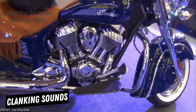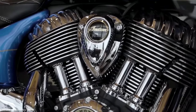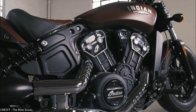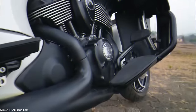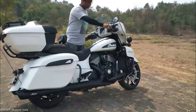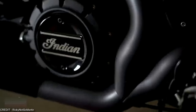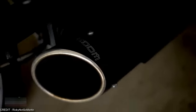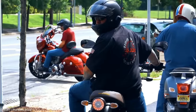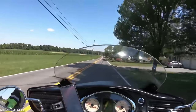Finally, the engine makes clanking sounds. Although the iconic Thunderstroke engine used by Indian in the majority of their motorbike models is a wonderfully engineered performance-based torque monster, one of the most prevalent complaints from Indian motorcycle owners is the sound of the engine clanking. The distinctive semi-dry oil sump on Indian motorcycles is usually blamed for the engine noise. A loud and rapid slapping noise can be produced by an engine if oil pools in the crankcase and isn't pumped out quickly enough, causing the counterbalance weights to slap against the oil pool. Piston slap on a cold start is to be expected on a motorbike with short skirt pistons, such as many Indians, and this could be another contributing factor.